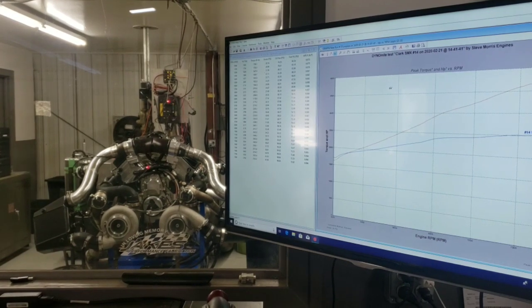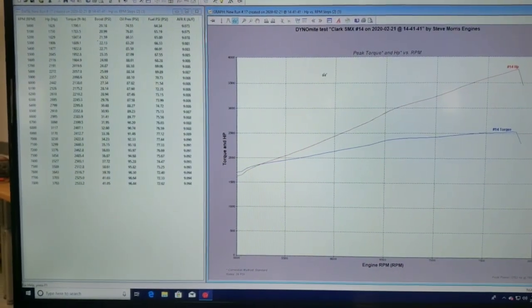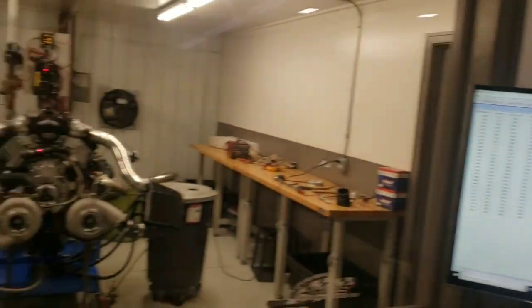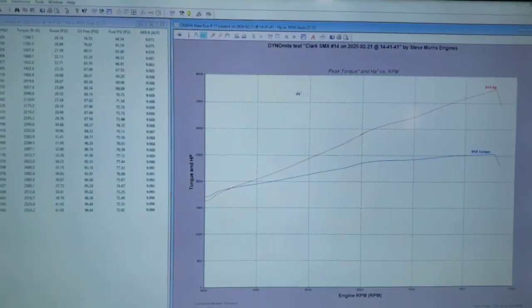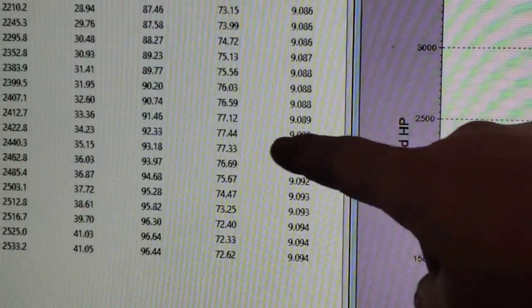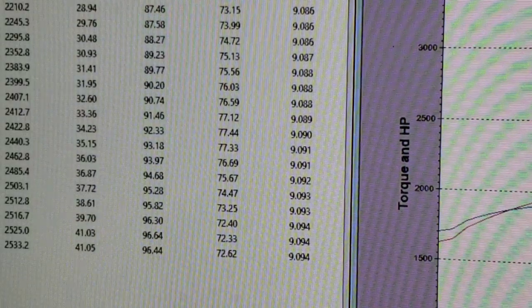All right, there you go. Let's see what this did — we did make boost. I'll take a look at the tune up here. Now I have this Holley VR2 fuel pump — just that big single VR2 fuel pump. And obviously that is the limit because I have got 18 volts going to the pump right now. My fuel pressure is not maintaining, it's dropping. So I'm going lean up here — that's just why I pulled back on the throttle.